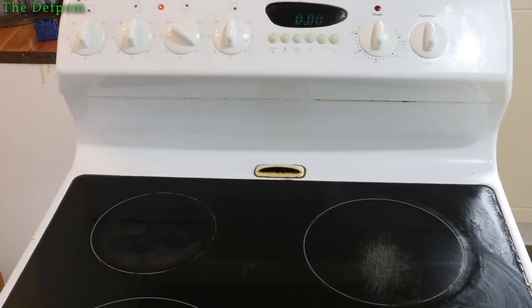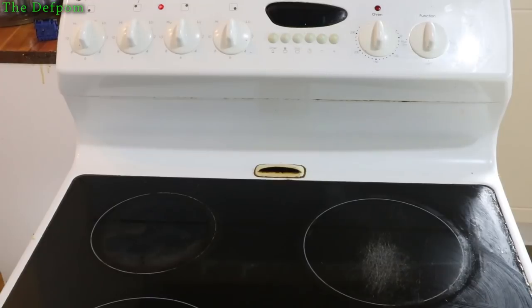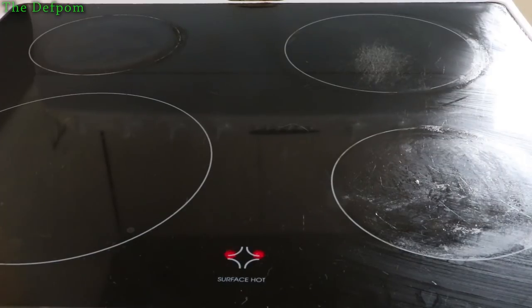What these work by is a bimetallic strip — it bends inside the switch. By turning the knobs you're changing the pressure on that bimetallic strip, and that determines how rapidly it turns on and off, so it changes its timing effectively. Sometimes it will be so fast it doesn't glow — it's still putting out heat, it just doesn't get to the point where it glows. I could hear it clicking when it didn't come up glowing, so it is working. There's also a glowy indicator right here saying it's hot — a nice indication that things are working like they should be.